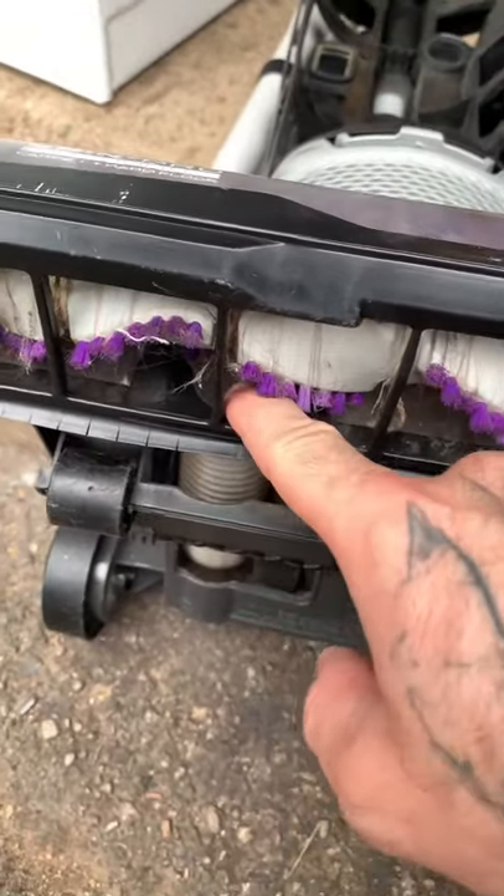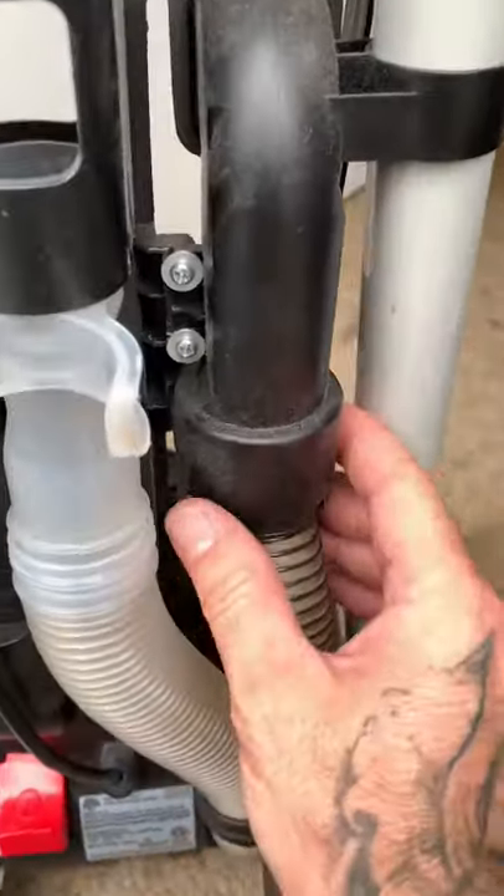Since the belt is fine, that means we have a problem with our hose — if the hose is clogged up anywhere, we won't get any vacuum at all. So we know it's probably clogged. We'll take the wand out using the wand release and lay that on the ground, then run up here and find where it goes in.